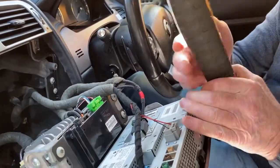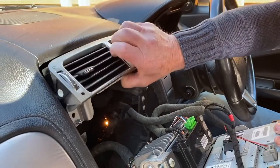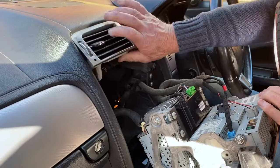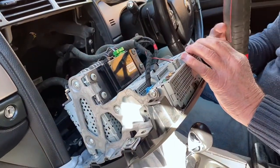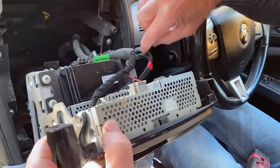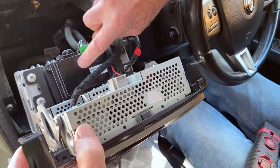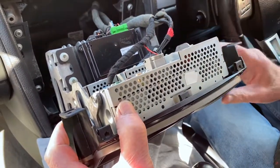When putting it back, if you want to take this piece out it just comes out from behind if you need to get anything behind the dash. If you want to take your module off, you've got four screws that hold your entertainment module on. Sometimes these go wrong — they can cause a battery drain or whatever, which you can check out.